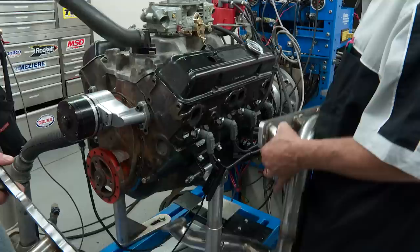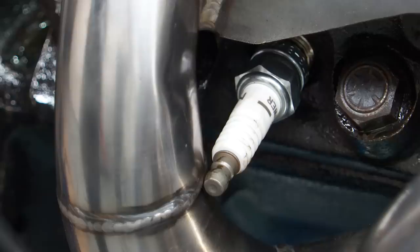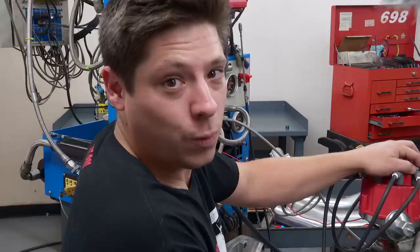If this were in a regular vehicle with a cross member or anything, it's gonna hit there too. We're about 10 minutes into putting the turbo setup on the motor and we found problem number one: there is no physical way you could ever possibly get a spark plug wire onto that plug — it's touching the header just resting there. So we're gonna hit it with a hammer.